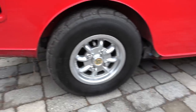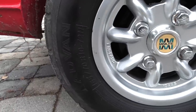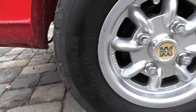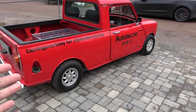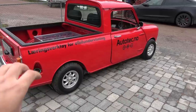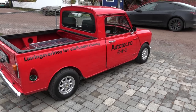Now the tires and wheels — original 165/70 10-inch, freaking 10-inch wheels. Fun fact: when the owner who built this wanted to do a wheel alignment, he simply couldn't, because the equipment you need to put on the wheels doesn't fit 10-inch wheels. You have to put on 12-inch wheels just for the alignment. But it is so small.